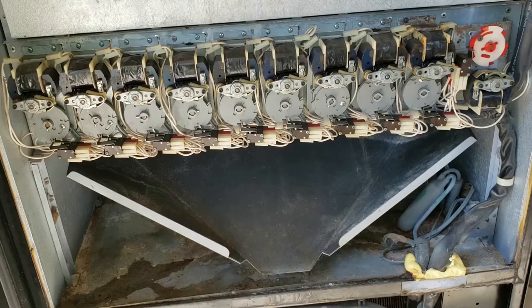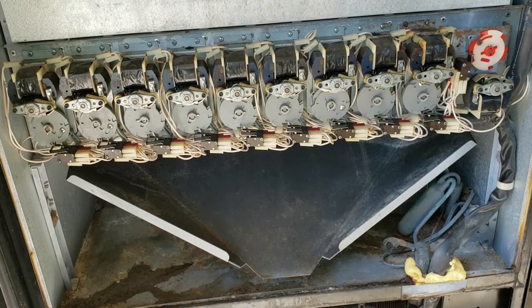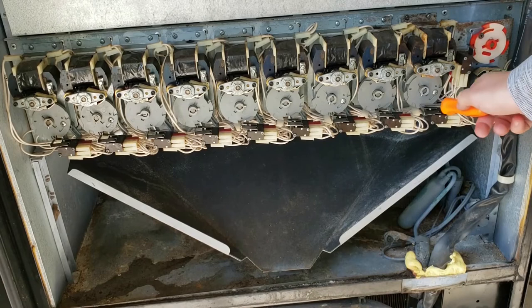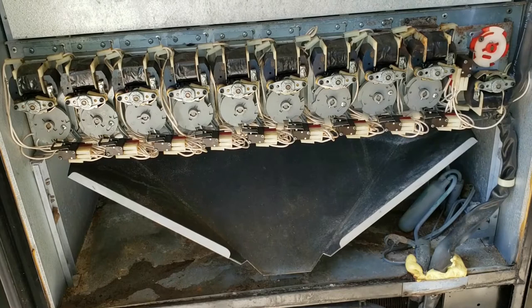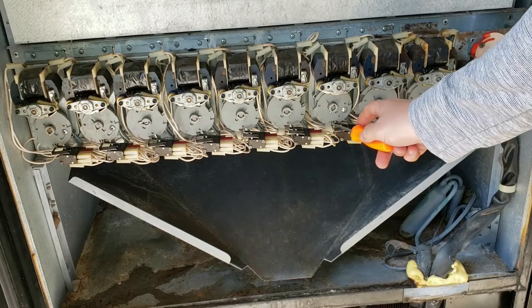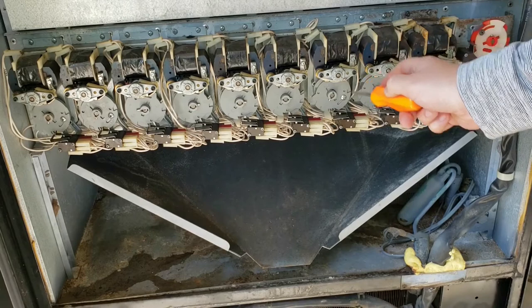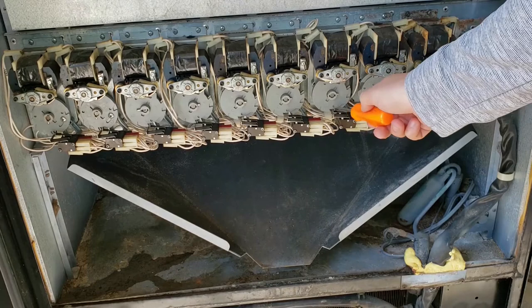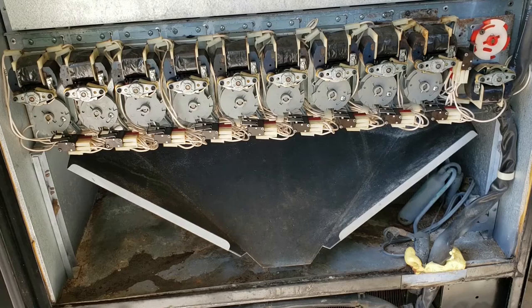Upon further inspection, this thing is just a grab bag of problems. We just cleaned out and inspected number two — now it works properly, stops immediately, and you get the macro switch still on the elevated portion of the cam. Number three gets a slow stop — both switches fall into the valley of the cam, so that one just needs to be cleaned. Number four: top motor spins, it's dirty too. The bottom only grabs in places, so this one's probably missing some teeth. Both fall into the channel — it's weak, needs new gears.